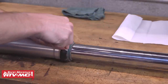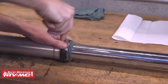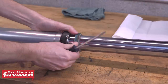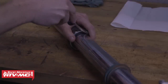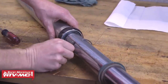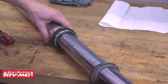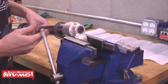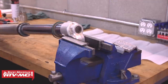To begin disassembly we're going to start by using a flat blade screwdriver and pry out the dust seal from the upper fork tube, carefully not to scratch the lower fork leg. With the dust seal out of the way we now have access to the retaining clip, and we'll again use that screwdriver to carefully remove that clip from the outer fork tube. We're just going to slide both of those pieces down the lower fork leg and then move over to our vise, which has soft jaws installed to keep from damaging any part of the fork during this process.